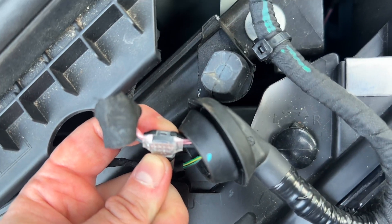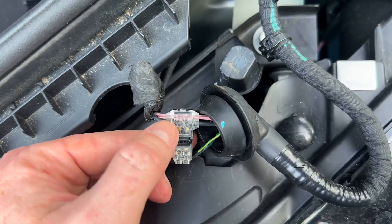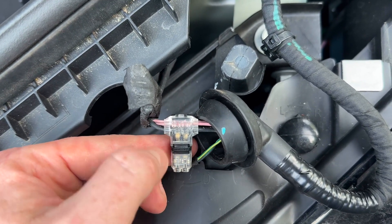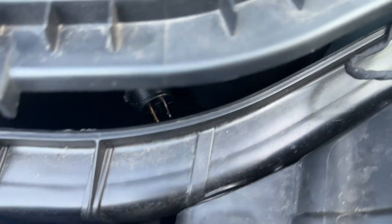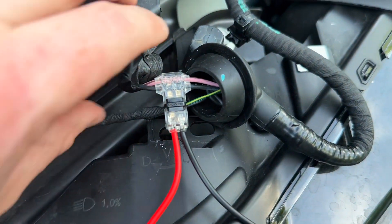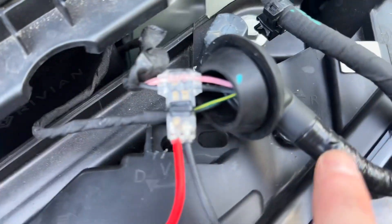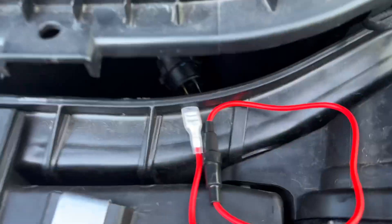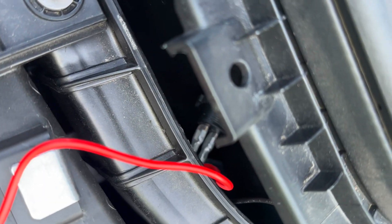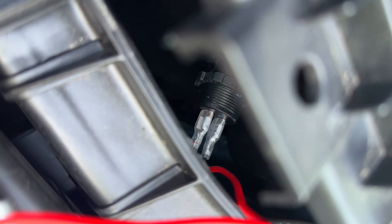Once you get some pliers on it and you pinch it down, you'll see there is a little tab on the back side that secures it. You'll see that the red is at the top, the red comes out the left, and the ground comes out the right. So now I can take this and bring it down to here — get those tapped in, red and black, squeezed tightly. You'll see the little pinchers on the side. Now we have juice from the 12-volt and we're going to bring it to here. We pop those guys in, and they have sheathing over them to protect from water. I'm going to throw some tape on there as well.